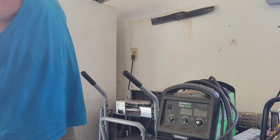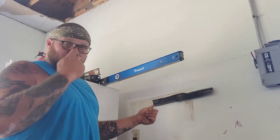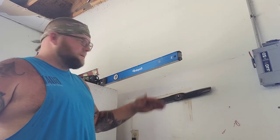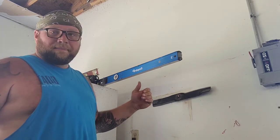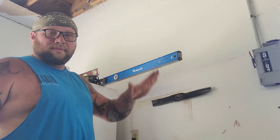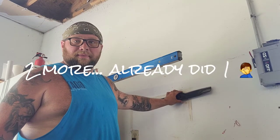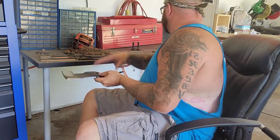See how it sits straight? Now it's equally balanced. The only reason that you balance them is that if you don't, it'll cause a wobble in your deck. You'll get a crazy vibration out of it, and it's probably cutting like that. I'm gonna sharpen three more of these and we'll put them back on. All right, so now that I got three sharp blades,